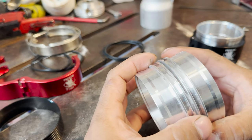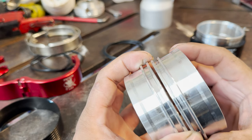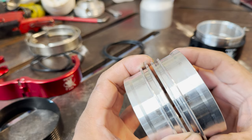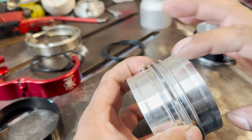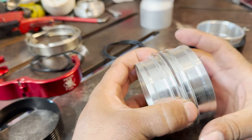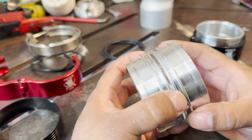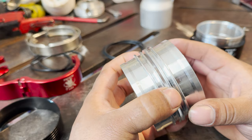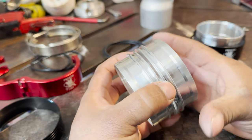It has a lip inside that, when these sit, spaces them out, I believe a 16th or something like that, or a 1/4 inch. So it's basically going to gap it like this. You clamp that on, and that gives you your proper distance on whatever material you're welding. The reason for that is that the good thing about HD clamps is they allow flexibility, and it's not 100% rigid. You don't want it to be 100% rigid because remember, your motor does move under load.